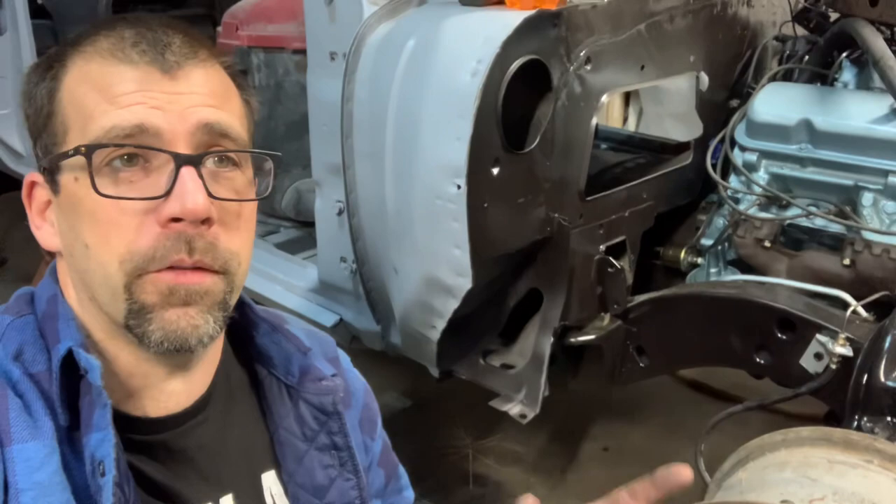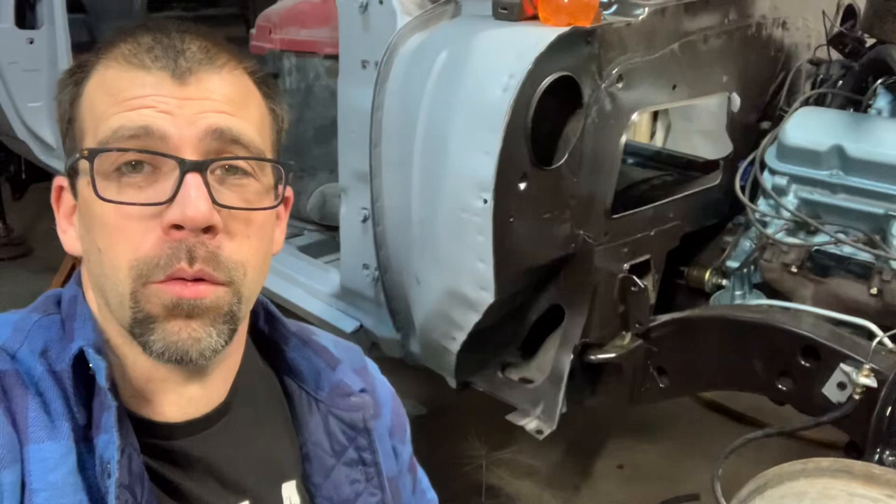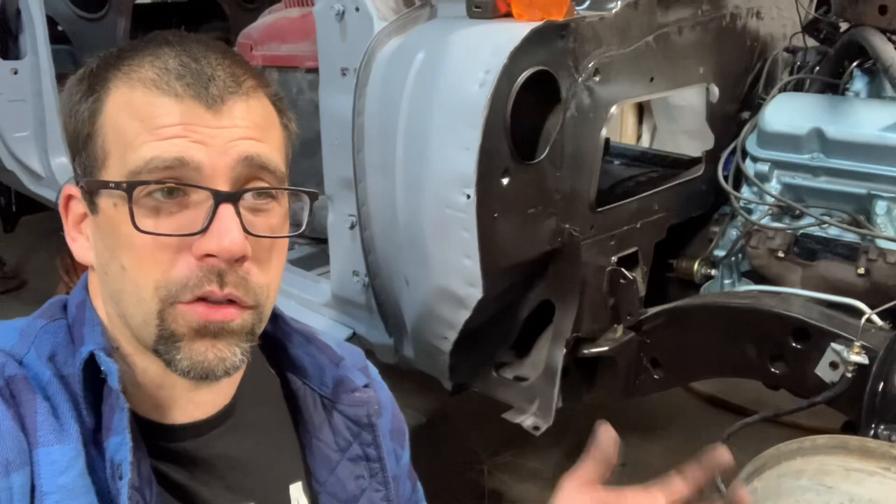The Great Pumpkin now has the ability to run 14-inch wheels — check this out, nice and quiet. It doesn't sound like a train wreck happening while rolling, because if I had torqued the lug nuts it wasn't going to operate whatsoever. So I hope this tip helps you out — buying the right components, shopping for the right components, or knowing what doesn't work will definitely help you out. Probably not the most exciting video in the world, but maybe you learned a little something. Next we're going to start working on getting the rear axle positioned into this car and show you the easy way to do it at home without scratching the paint.